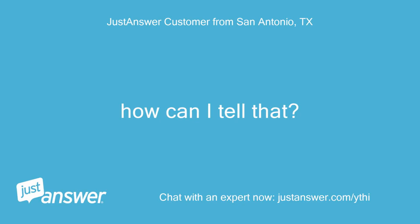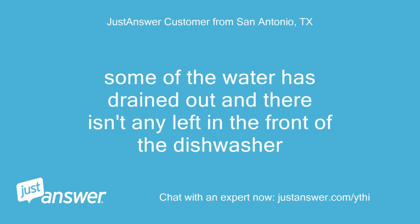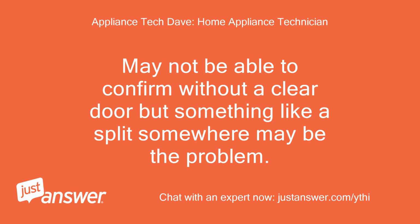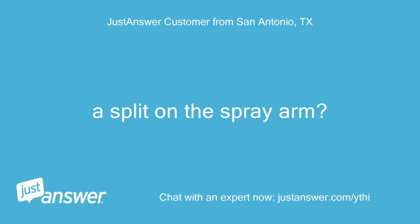How can I tell that? Some of the water has drained out and there isn't any left in the front of the dishwasher. Sounds okay. May not be able to confirm without a clear door, but something like a split somewhere may be the problem. A split on the spray arm.